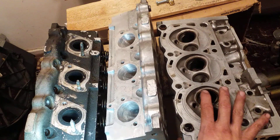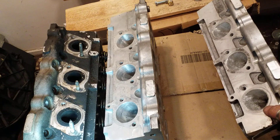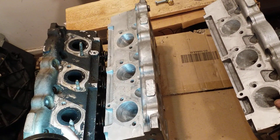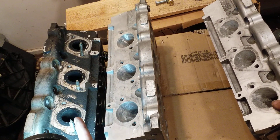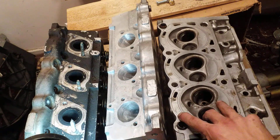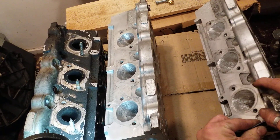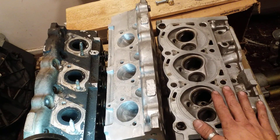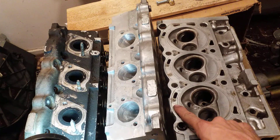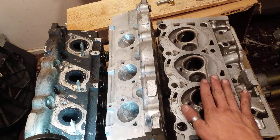What's unfortunate is specifically with things like the M112 supercharger swap — people do that and it's kind of a bad idea. It's cool if you want to blow up your engine within two summers. If they don't port your exhaust manifold side of your head, that lip right here is going to get hot. From that blowback — intake, compression, power, exhaust — that blowback is going to hit that engine cylinder and make it hot. When this doesn't have the ability to flow coolant here, this is going to get really hot on this lip, literally directly above it. So when people talk about right around 175,000 miles every single V6 Mustang having head gasket issues — that's why. It's from the run cycles of the engine hitting the life of this area, and anybody who's ever seen their heads when they take them off can pretty much verify that's where they're coming through.